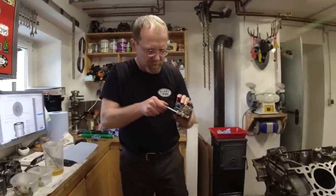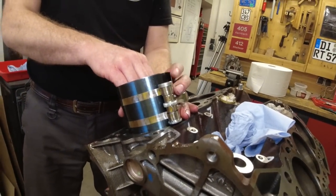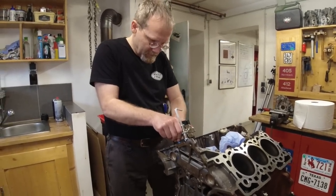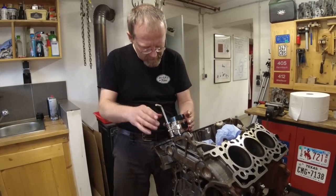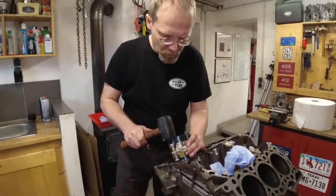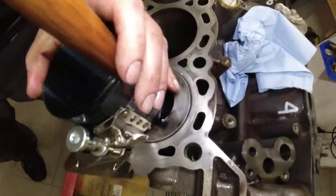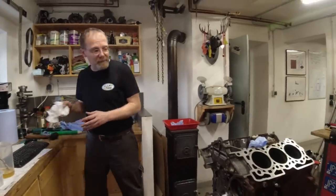That's about the stupidest tool you can use for this job. I put this over the piston like this, then lift the piston up a little bit, and ask Vera to hand me the tool. Then I tighten this up — if I have to do any cursing I'll cut that out of the video. The risky part is that you can snap the oil control ring with this method using my cheap Chinese tool. I gotta watch out that I'm not hitting the crankshaft. And you see it went in all smooth — perfect. There was no clunking noise from snapping the oil control ring.